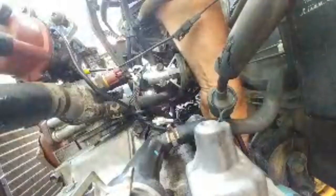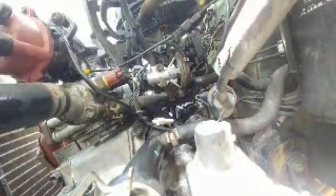Alright. Okay. And this bottom one that I'm working on right now, it wasn't even installed in the last starter. Alright, so what I was dealing with earlier is there's like a shoulder pin, I guess would be a good term, that slides in the bore of those holes, and the diameter is a little bit different, so I don't want to get too aggressive with these bolts until I'm sure everything's home.